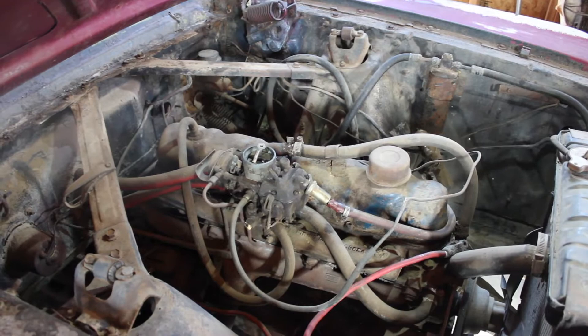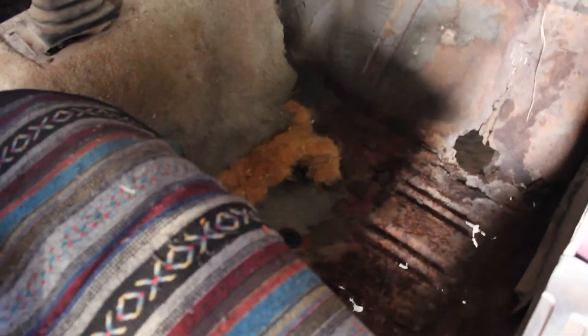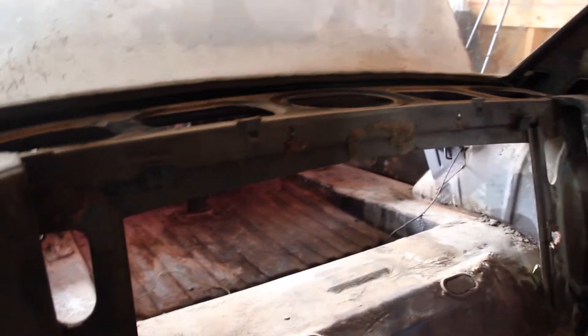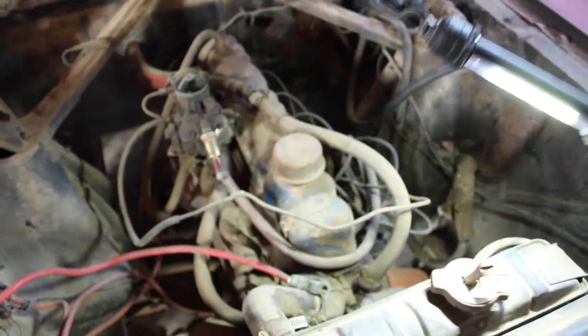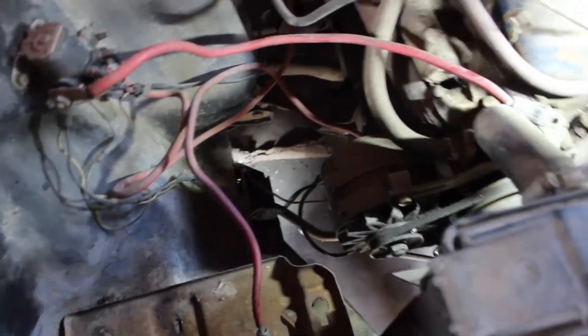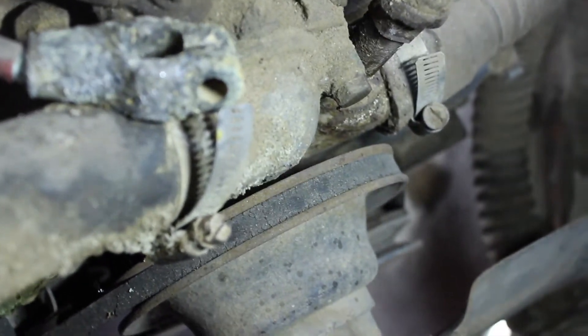We cleaned up the car, added a seat cover, and you can see the rust holes a little bit better now. Took the headliner out, and all the wasp nests are out but we kept it in case we need a template to use. We do have the battery on the trickle charger — it was at about 11.8 volts when I checked it earlier today, so I've got it charging. One thing I want to draw attention to is this belt on the front of the engine — it's very cracked. I would not really trust it driving anywhere, but for us to fire it up, it's fine.